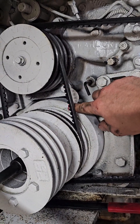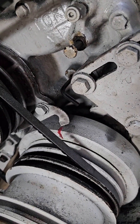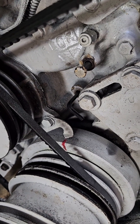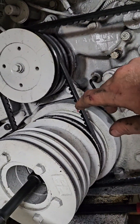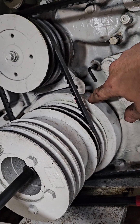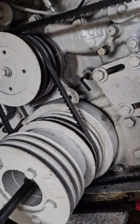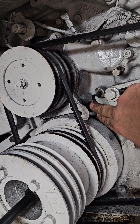The tech manual will state rotate until the top dead center mark comes in contact. If you know four strokes, that means you're going to have two rotations for that top dead center mark. Now we're just identifying true top dead center — rotate the engine and insert the pin.